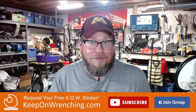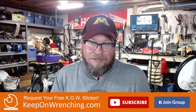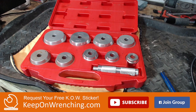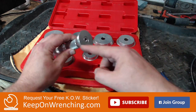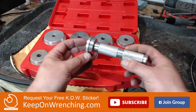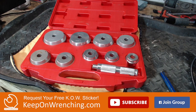I really wish I would have known about the blind bearing puller a long time ago, because on my first two bikes I suffered trying to knock bearings out with a punch, and you ultimately end up doing more damage than good. Next on the list is a bearing and race installation kit. This has made life so much easier — you can find the little inserts that match your bearings or races and actually drive those in without doing any damage. It's going to save you a ton of time trying to find the right socket, and it's invaluable. Don't wreck your bearings when putting them in.